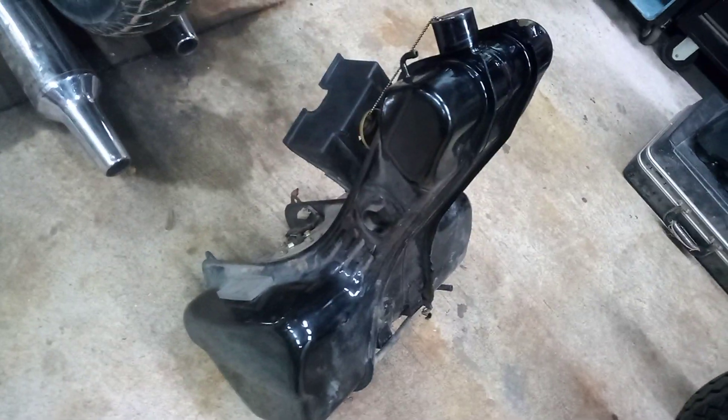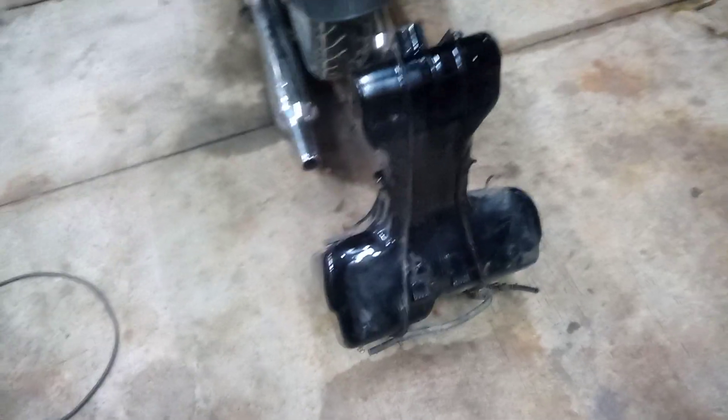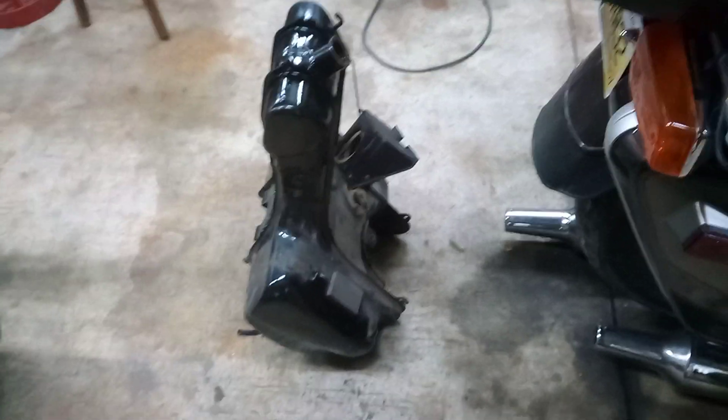I shined it up a little bit the other day when it was on the bike, but I think that'll be cleanable. What I used to do is get a handful of nuts and bolts, throw them inside the tank, and shake it around with a bunch of gas and oil in it — try to clean it out, dump it all out, and see if any sediment comes out. There's a lot of sediment in there; it was plugging up the filter.